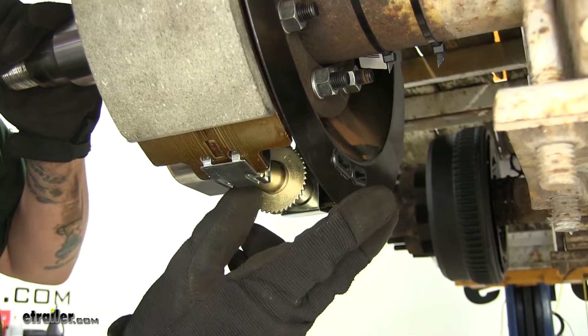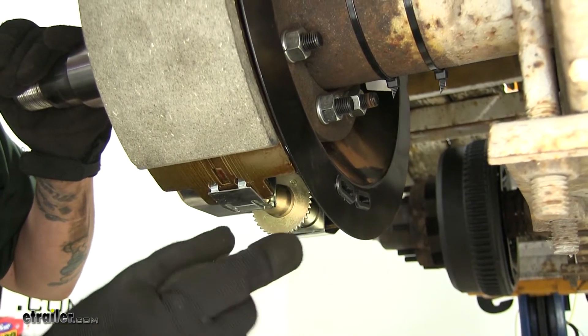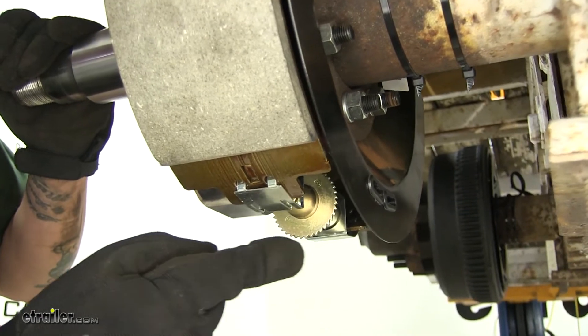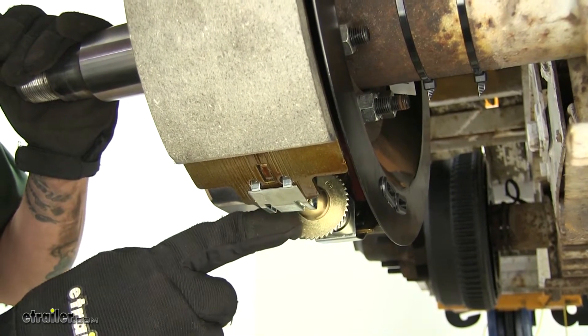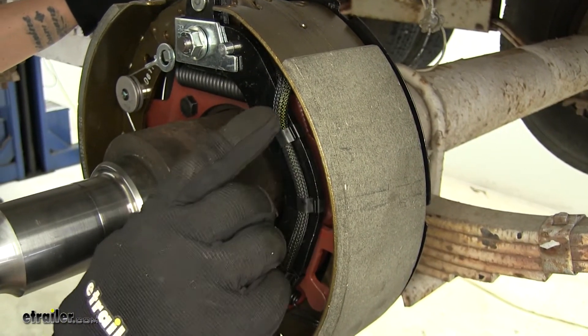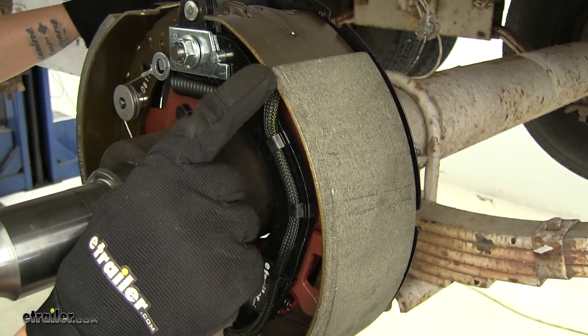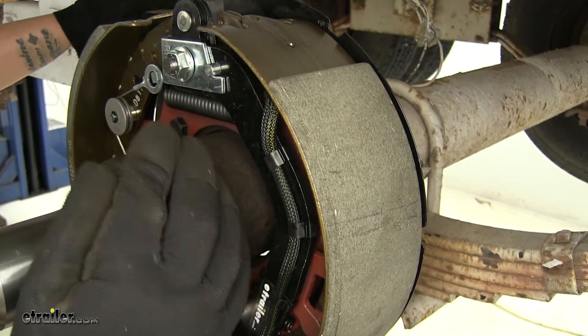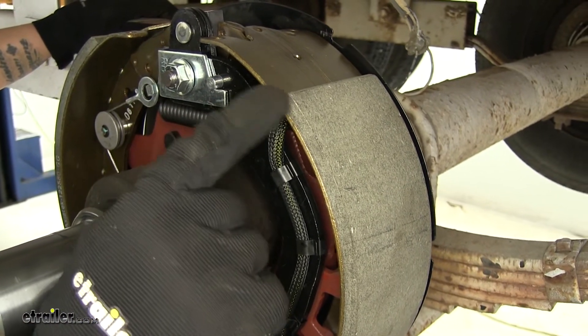The way we're going to make our initial adjustment is going to be at the plug back here — it's going to keep all that dirt and debris out from the inside of our brakes. We're going to have a fine-toothed gear to get our brakes set how we like them and set the initial tension. Our pads are going to be bonded, not riveted, so we're not going to have to worry about those rivets gouging into our drums. And they're going to have a nice tapered edge that's machine-cut rather than snapped off, so we don't have to worry about any kind of chipping or breaking on the edges.